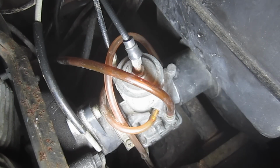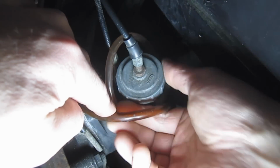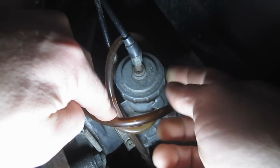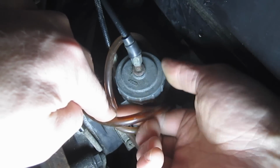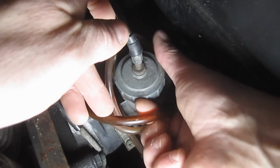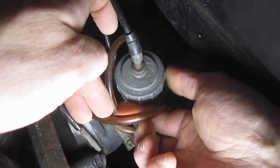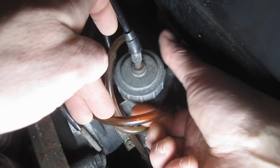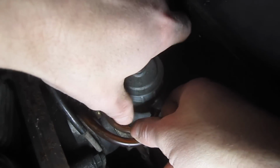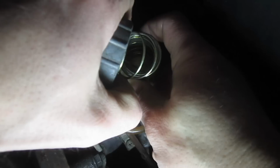Alright, so I hauled the sled inside here in the garage. I'm going to start removing this throttle assembly here. I've had mine off because I used ether to get it started. You may have to take some channel locks or something if you haven't had this off. And when you pull this out, you want to be a little bit careful, because there's a spring that retains the cylinder onto the end of the cable, and if you compress that spring, the mechanism can actually come off, and there are usually some small washers and things that could be lost.